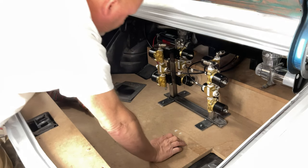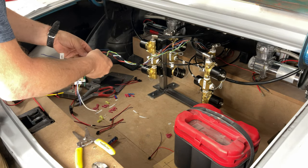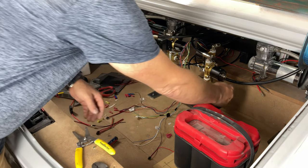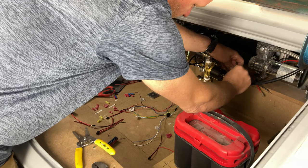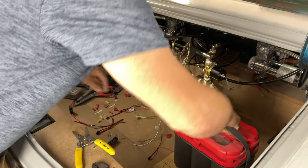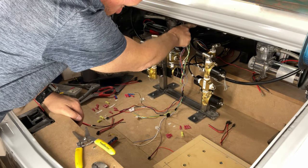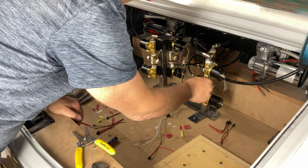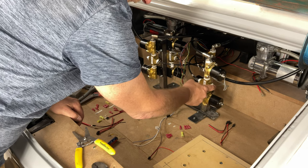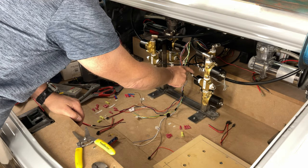Now I'll put some zip ties on this to tighten it up and make it look pretty. Here's how you wire it all up — I've got a little wire system with the different pairs. I'm only wiring up the rear bags right now. Each corner is just a separate thing, so once you figure out one corner, you repeat the process for all four. Each corner has two valves: one to let air in from the tank, and one to let air out. Air comes in, pressurizes down to the bag, then closes. This line feeds the bag — this will go to the right front bag.